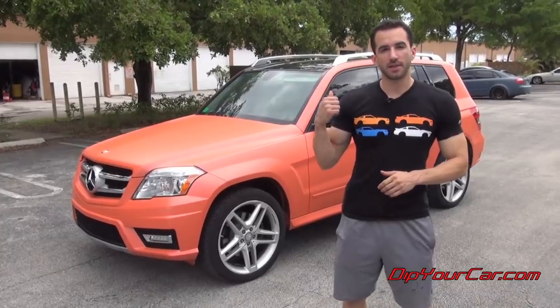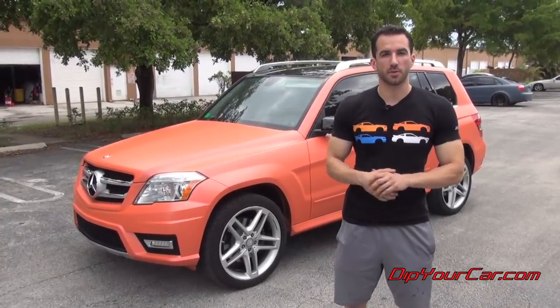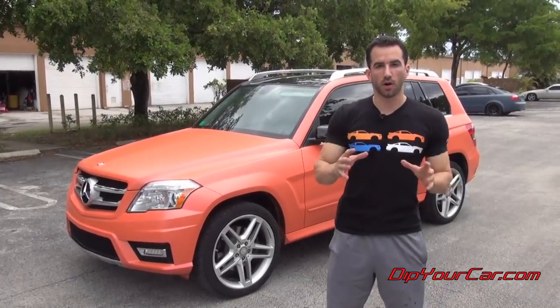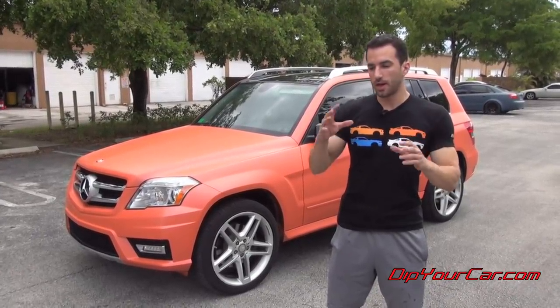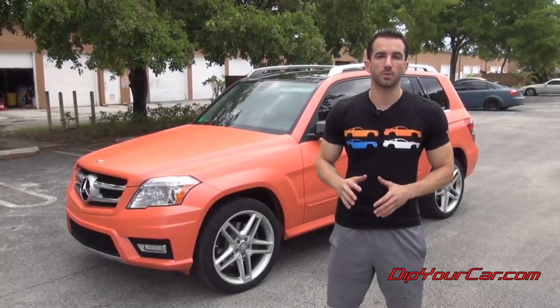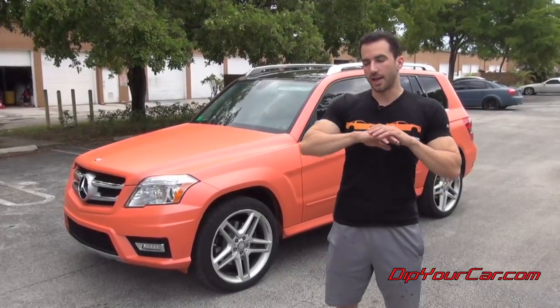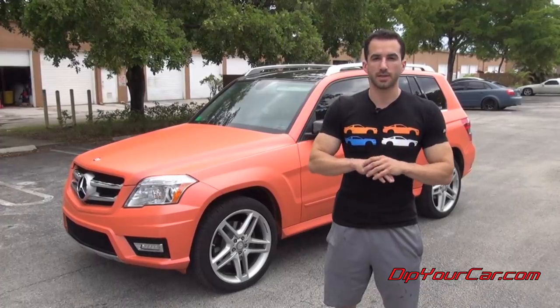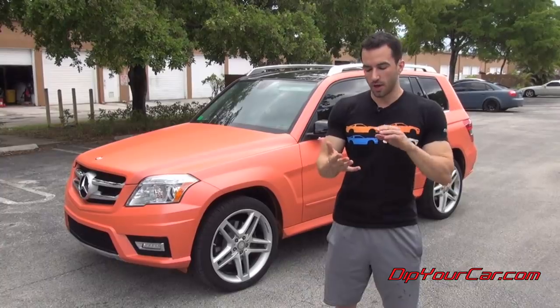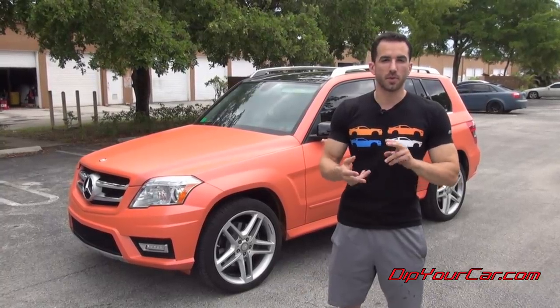All right, behind me is the world's first car that's dipped with pearlizer in liquid form. And what we did, like you saw, is we took the koi orange, we mixed it 50% koi, 50% pearlizer for the last two coats. It came out awesome. We're so happy with this product because it opens up the color spectrum for Plasti Dipping cars tenfold. It makes everything way more exciting. You can do pearl black, pearl blue, pearl anything.